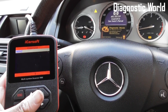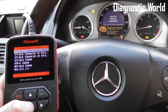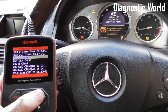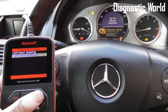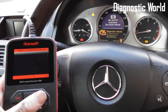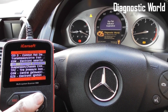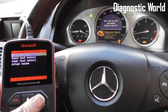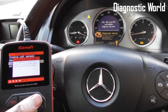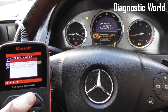We'll go back into the same options as before, selecting our vehicle, and then we'll clear fault memory straight away. Hopefully we should see an end to the ABS lights on the dashboard. When I click OK here, just keep one eye on the ABS lights on the dashboard.